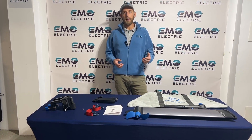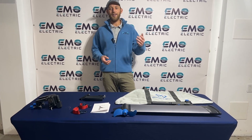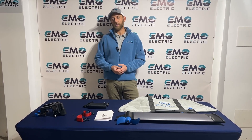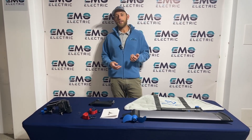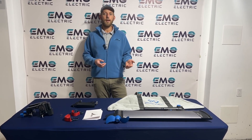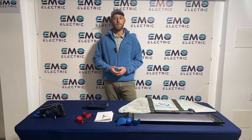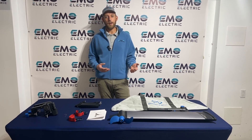The only things people buy extra with the E-Lite are a spare prop or an extra transom bracket. Unlike the Spirit battery, neither the E-Lite nor its transom bracket floats, so you have to be a little more careful with it. The prop is made from plastic with a shear pin inside — in the event of a grounding, the shear pin or prop will break before the motor itself is damaged. If you have an extra prop and shear pin on hand, it only takes a couple of minutes to swap and you're back on the water.